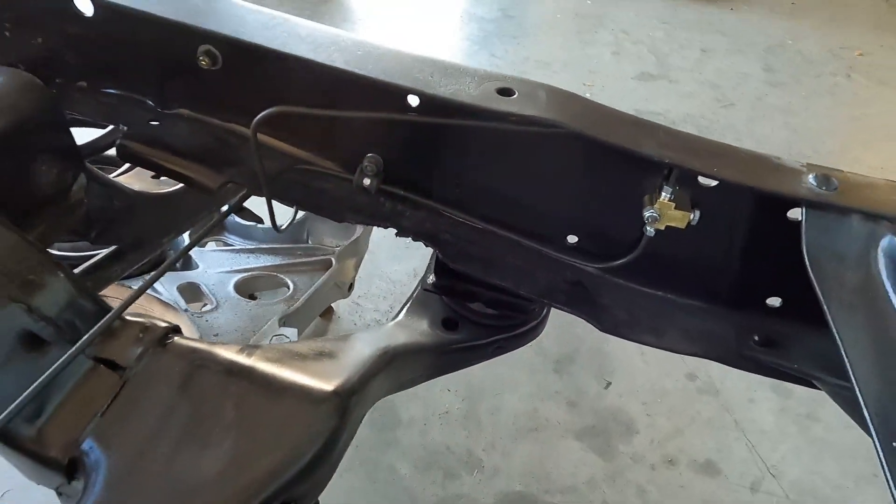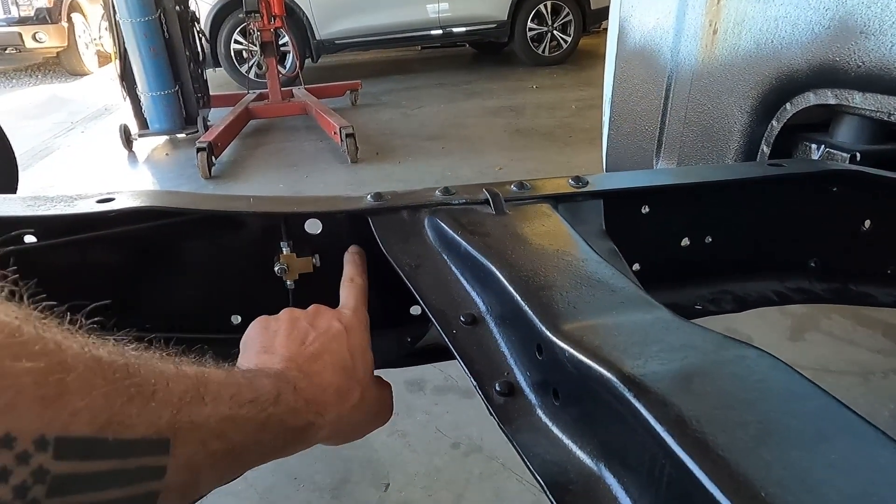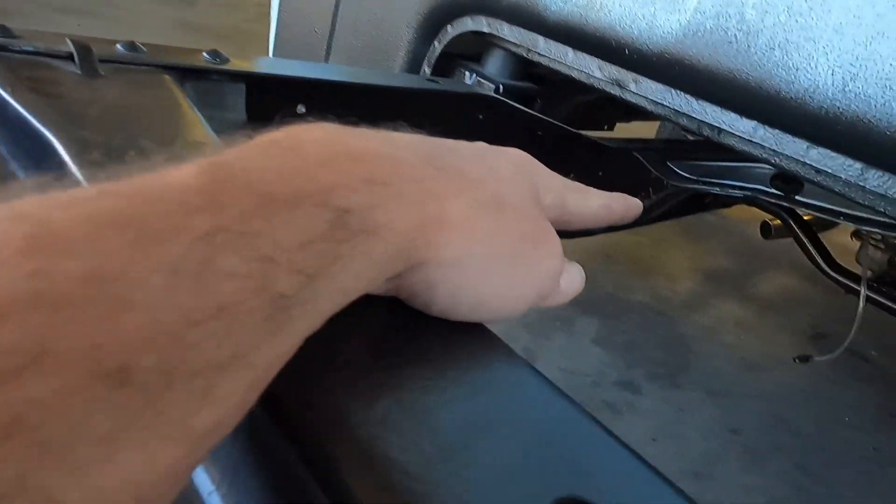That's going to be just fine. I realize there's no reason in running this brake line from the front and plugging it in here when that'll be fairly easy to do from under the truck, just inserting that one in and snugging it up with slight bends all the way to get to the front. But that's brake lines — flaring for double flare and bubble flare, identifying the types of fittings and the application on the female side for which flare to do, and a couple of the tools you should use. I'm pretty stoked — that's maybe a small step for man but a giant leap for the truck build. Also getting those rear suspension bushings — noticing they were just wasted and getting those replaced is much handier to do now than whenever the truck's got the bed bolted on. Next week we'll probably start cutting on the bed to make it fit on this customized chassis and get our shock mounts welded on finally. I appreciate you guys watching, we'll see you next time.